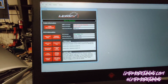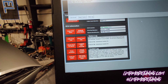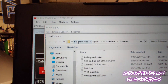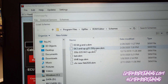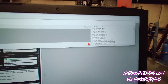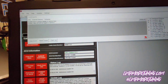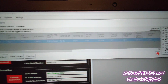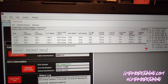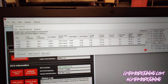Once the vehicle has started, you're going to select Logging and Tracing. You're going to go to Schemes, then Load Scheme File, and pick the one we send you for your vehicle. Hit Open. That's going to select parameters over on the side. Then you'll follow the directions for what we've asked for and hit the record button — you'll start to see data going. Record how we asked you to, then hit the button again to stop recording.